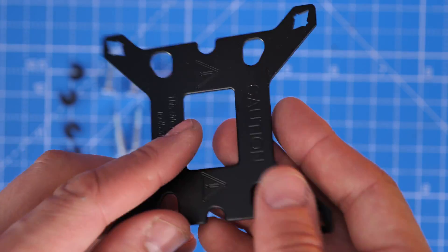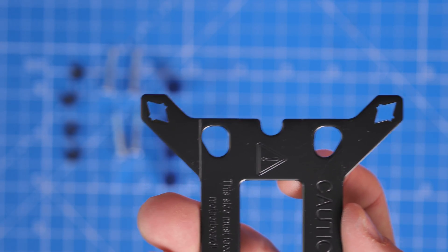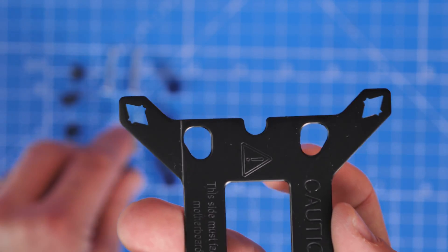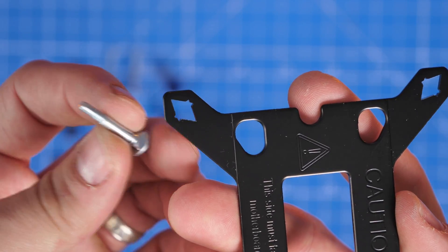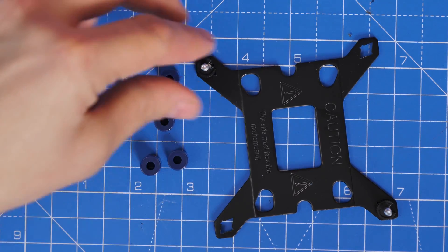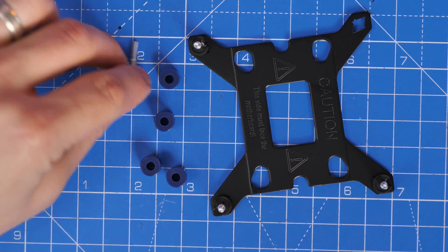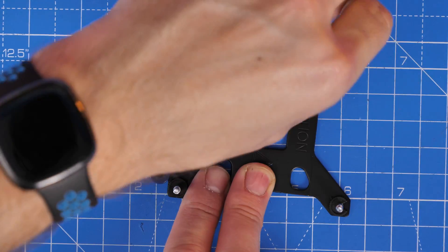This back plate is used for LGA 1150, 1200, and 1700 sockets. For 1700, which is what we're doing, use the far corners — there's a diamond shape in each of the four corners. Put the screws through there, making sure they're secured in the furthest part of the diamond notching — just line up the pointy bit with the corner, push it through, and secure it. Then there's a little plastic clip that goes over the top of each screw to hold it down. The four screws go on, then the four clips go on each screw, and these standoff screws will pass through the motherboard and pop out the other side.